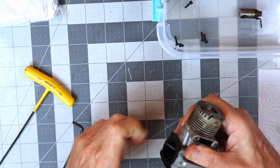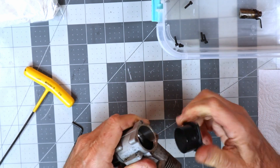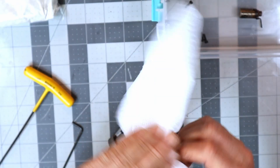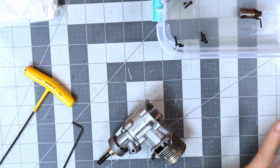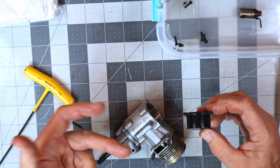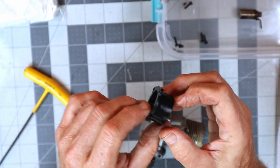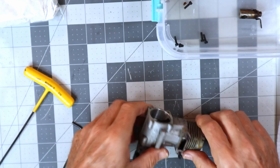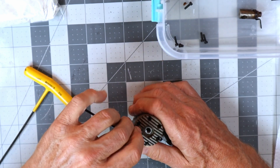One thing I noted in the reviews - there were several reviews on these 40-sized Irvines. There was a Q40 or something like that, ABC or whatever, and then a Mark 2, which I thought this was. The reviews said the Mark 2 had composite backplates that were O-ring sealed, but this is obviously not O-ring sealed because it had a gasket seal. Let me go ahead and pop the head off before we go any further.